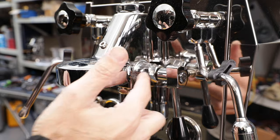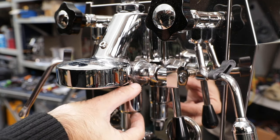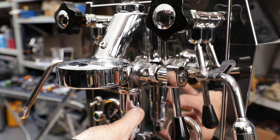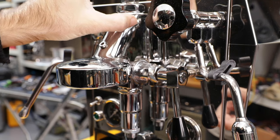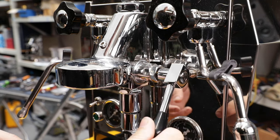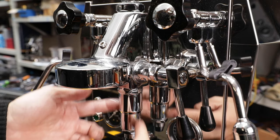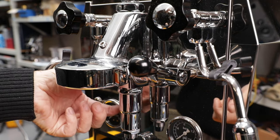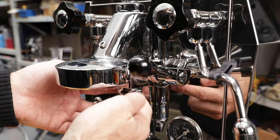The anatomy is that this lever operates a cam and several different pistons inside the group - there's one in the top and two in the bottom. This is a pre-infusion chamber, which saturates as the pressure from the pump increases inside the machine when you're brewing. This is the exhaust portion of the valve, and in here is what we call a mushroom valve, with generally two inlets for the heat exchanger and a restrictor or gicleur in the very top. The lever group is the most common variant we find on domestic machines.